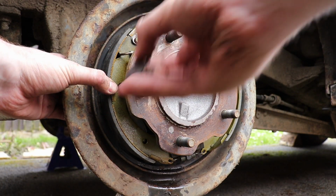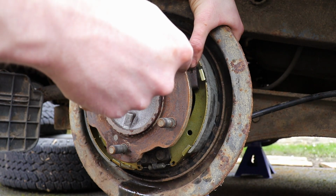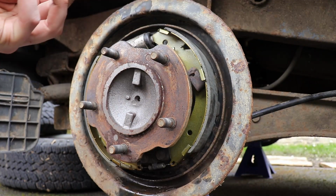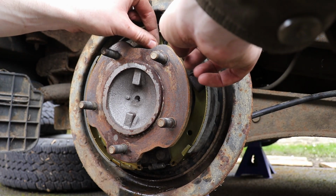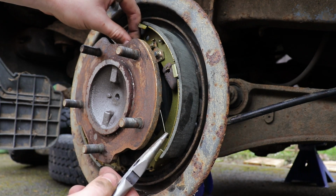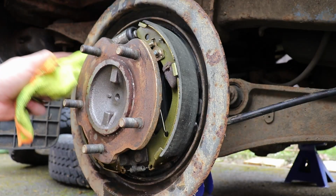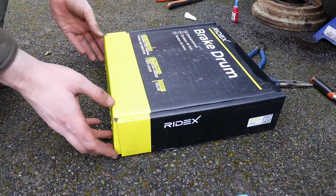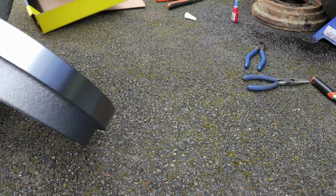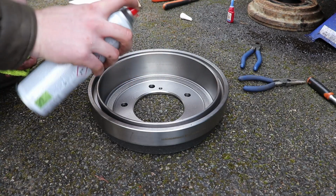After that, I pushed those little pins through the back plate and pads and pushed the clip back into place. Everything now firmly held in place, I hooked the tensioner's spring in place. Ever so slightly made some adjustments, and gave the outside contact points of the brake shoes a clean. After trying my hand at being an unboxing YouTuber, but ultimately deciding it wasn't for me, I gave Jimbo's drum a clean to remove the devious amounts of oil it was coated in.